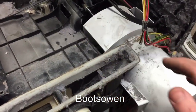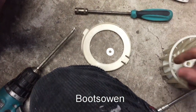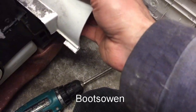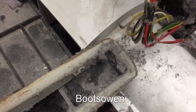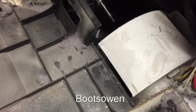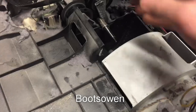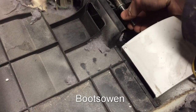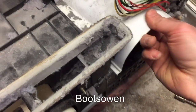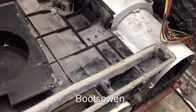To get in here, it's not that bad actually if you want to change a belt and you knew how to do it. You take off this cover here, which was down on the front. Then you reach in and pull out this thing. Then you take off a 10mm nut on the front of that fan, which is in there. Pull the fan blades out. Then you can pull out this white thing. You don't really need to take it out any further because then you're in at the belt here. Just flip that off — wiggle, wiggle — and that's your belt. Then you can put it all back together, or you could just leave it. I'll push some things back in and leave the rest. I'll reassemble the front and then move up to the top.